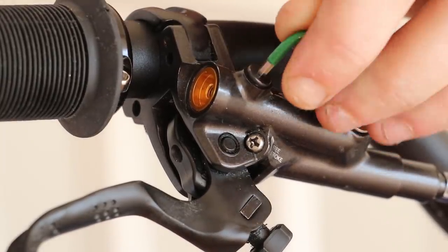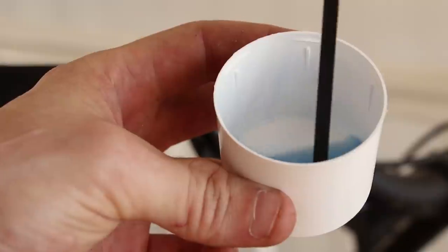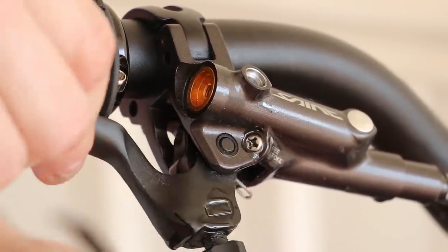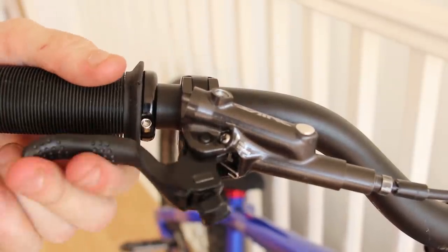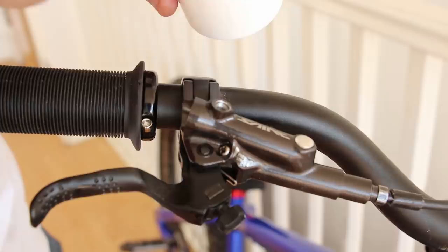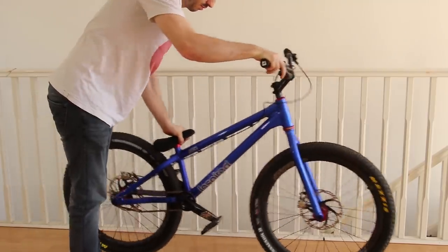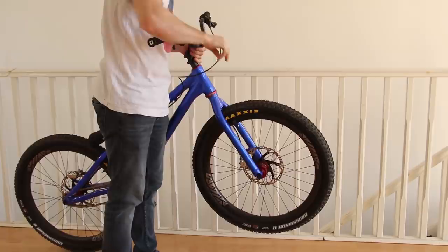I also use this technique to fill these levers when they're new and completely empty. First remove the lever's bleed port. Add your brake fluid to a smaller container, then use the zip tie to pick up a drop, and put the drop into the lever. Capillary action will usually suck it from the zip tie into the lever — giving the lever a squeeze will help. It will take a little bit of time but it's a surprisingly quick way to fill the lever. To make sure you've got all the air out, rotate the lever and give it a few squeezes, and top up if needed. Once full and the lever feels firm, refit the bleed port bolt and give it a wipe down. Note that this isn't a substitute for a full brake bleed — if you've had air enter at the caliper then this technique won't be as effective as a bleed with the correct tools. But as a top up for a lever spill it works great.